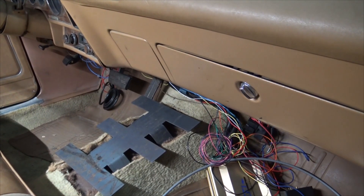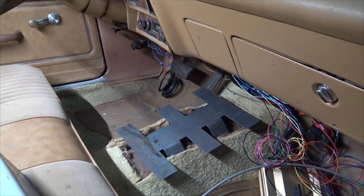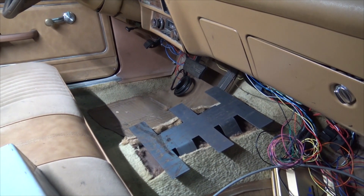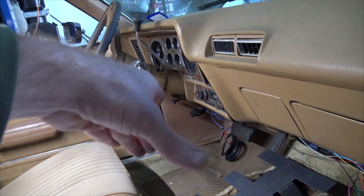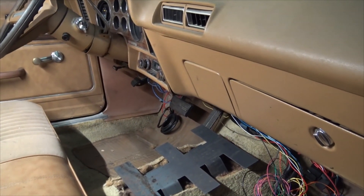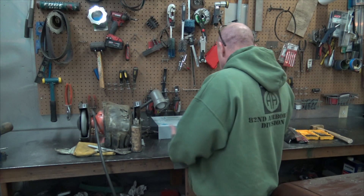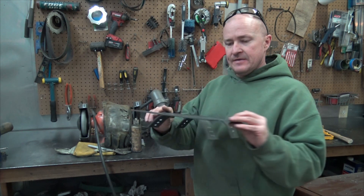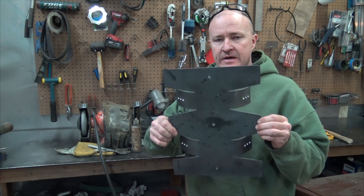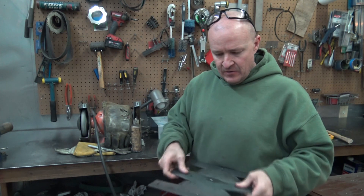And when I tack it on, I can tack it down in four different places. And that should — you see how it has to kind of suck in — once it's tacked down, it'll kind of make it rigid. And that's pretty much what we're looking for. So we got the row one cut out, the one-eighth inch plate. And you see, I just kind of triangulated some stuff to kind of add some rigidity in there.